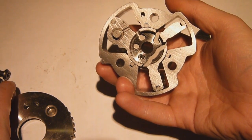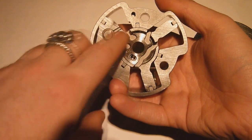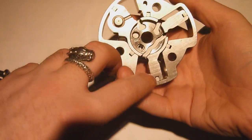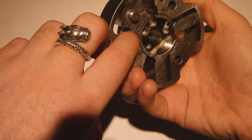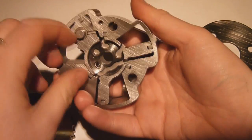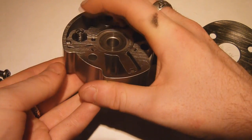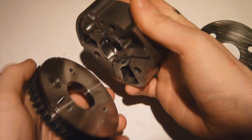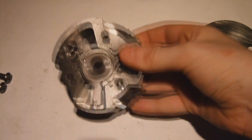And then if the engine wants to go back to where it was before, it diverts the oil pressure from these chambers here - and there's another one there - to that chamber, that chamber, and that chamber. This chamber is actually fed through the side here, and it will rotate it back to its default position. Because the oil pressure is no longer going to this piston, this piston has now been forced back down by the spring, and it locates back into its little seat there, and the stator is back into its fixed position.